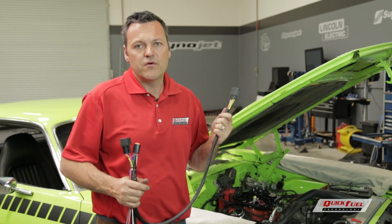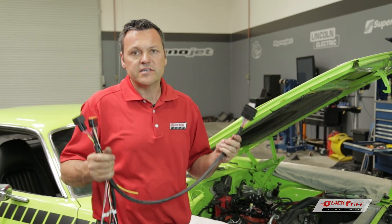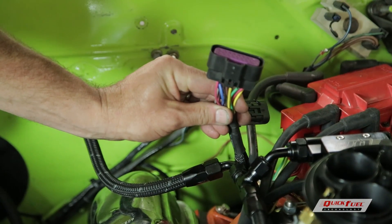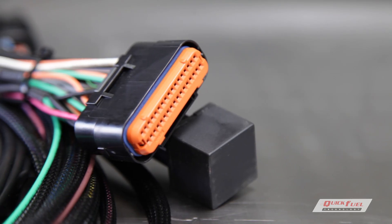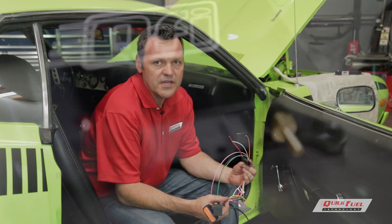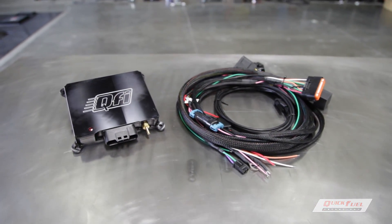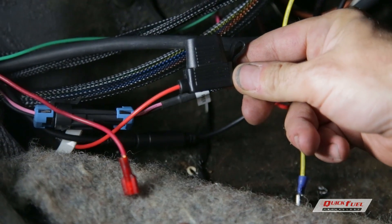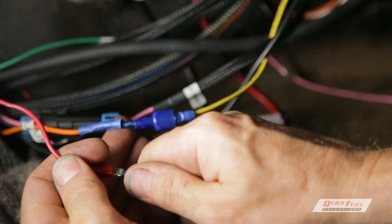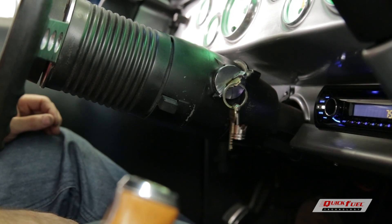With the fuel system buttoned up, we're ready to move on to the wiring harness. We're going to install the ECU inside the car on this build, and install the main harness inside as well, passing the ECU main connector, connecting to the sub harness on the throttle body, which is pre-installed, making it an easy installation. The harness contains 11 color-coded wires, and the instructions make it easy to follow through different ignition system setups. We move on to installing our fuse 12-volt to the positive battery post, our yellow wire to the fuel pump positive, and our pink keyed switch wire to the keyed post on the ignition. Be sure the key switch is positive during cranking and when the ignition is on.